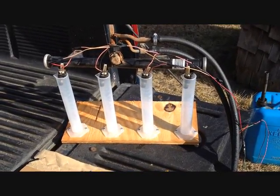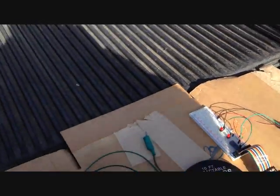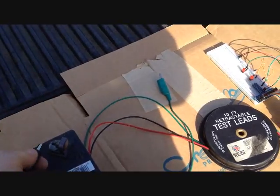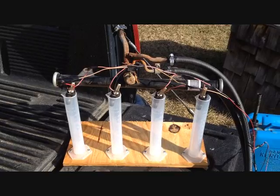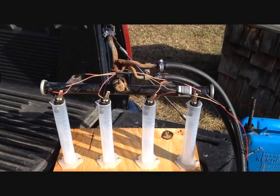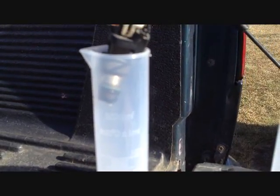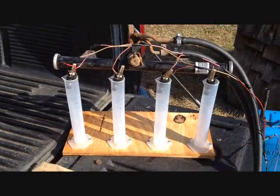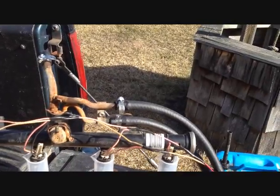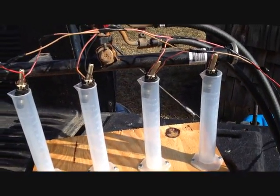Then I'll stop the video, empty out the containers, and do a dynamic test to see how that works. I'm going to hook up the fuel pump and the injectors now. I can kind of hear the air bleeding out of the system and you can see that one's already dripping. So, proof of concept — that one's leaking. We're going to do it now: 10-second static flow.